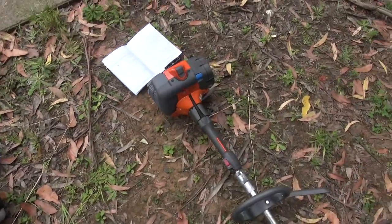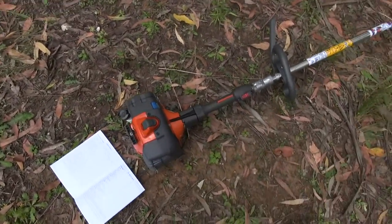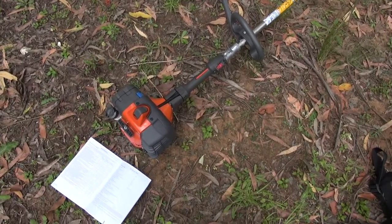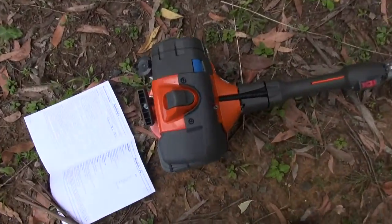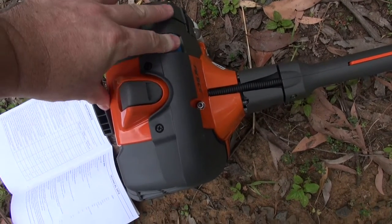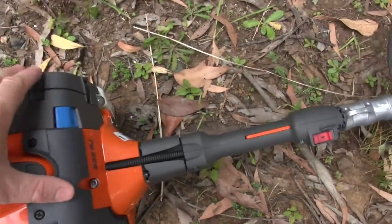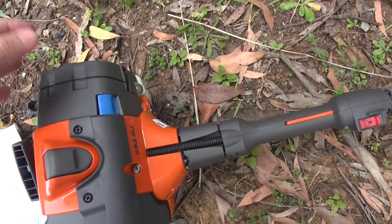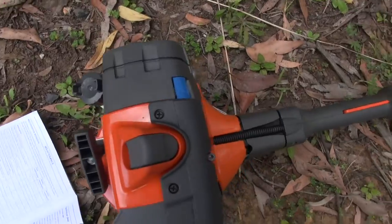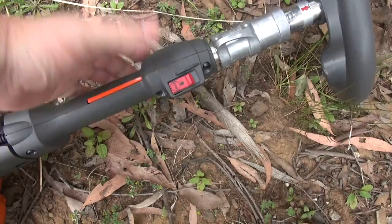And if I go over to the Husqvarna, as I said, smaller motor, same sort of power. There's some other things I quite like about it. So things are in easy reach and accessible. So choke is easily done there. The air filter cap is just clipped on, so you put a screwdriver under there and flip it open, you can get the air filter out. Nice screw cap for the petrol. This stop switch, as I said, is a return switch, so it returns.